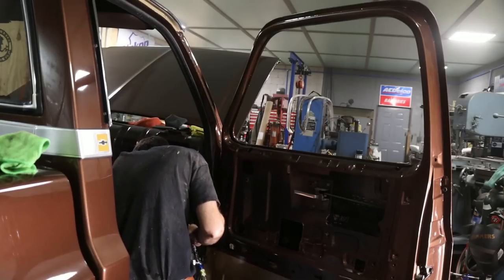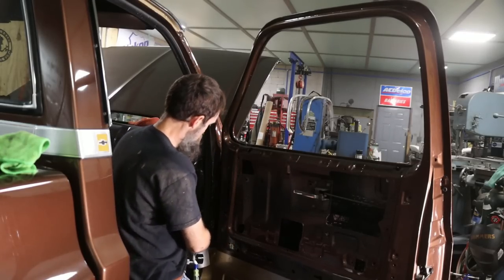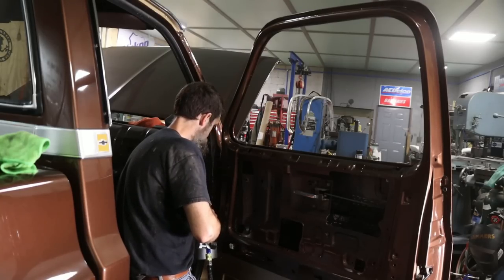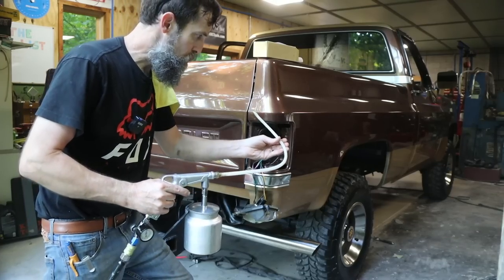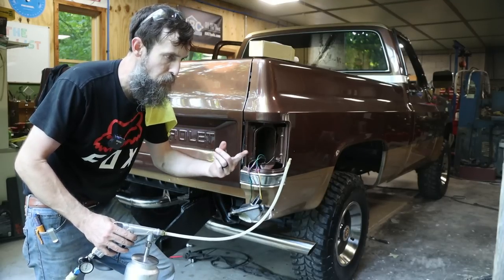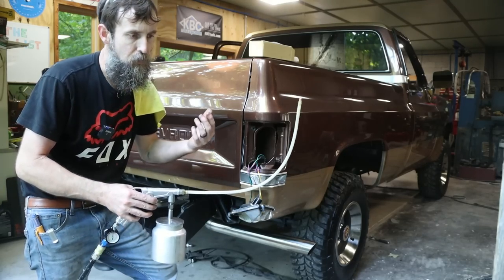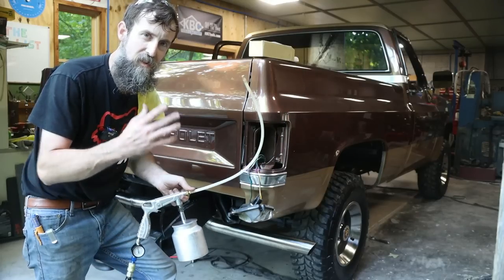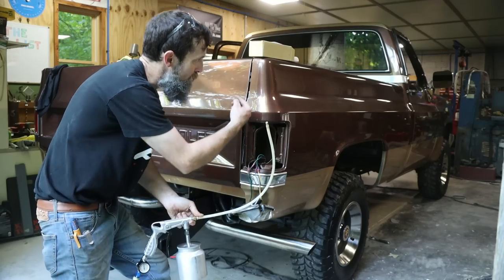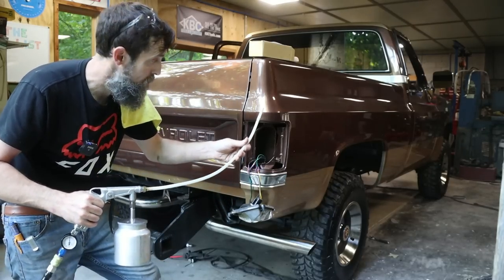In the kick panels — we had a mouse hotel in there and I took this thing apart. I wish I'd known about this tool 10 years ago, because in the past I just used used motor oil, transmission fluid, gear oil — whatever I had — in a spray gun. I have that SureShot sprayer, but it only sprays in a straight line, so you can only get pretty much line-of-sight stuff. You can't really get up in these bedsides and coat the entire surface like you can with something like this. I like this a lot.